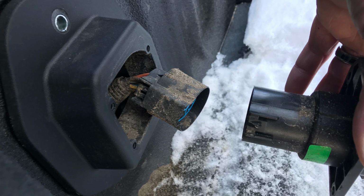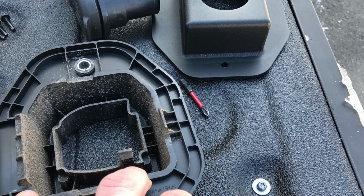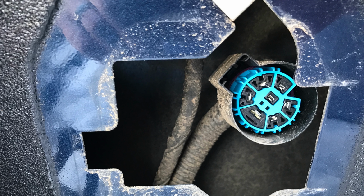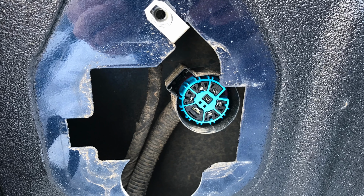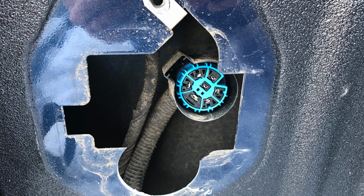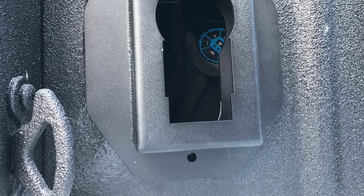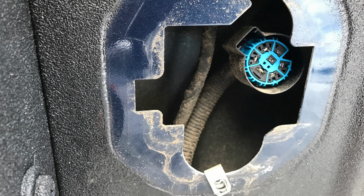First, you remove the 7-pin connector and the plastic box that's in behind it, and then using the Nichols Welding kit you can find online, you'll drill a new hole at the bottom of this existing opening, using a 2-inch diameter hole saw. That opens this up so that you can use the 7/12-pin connector.